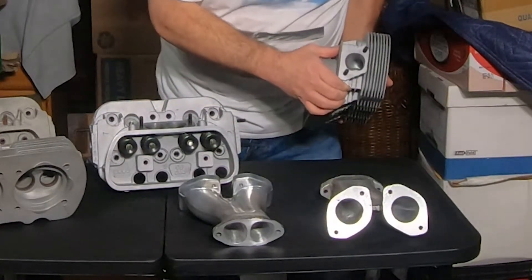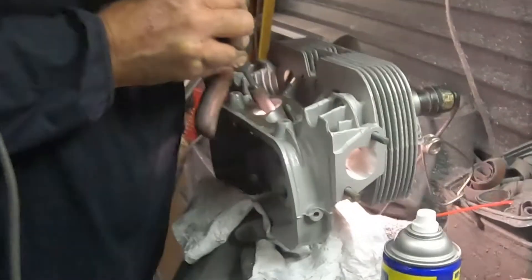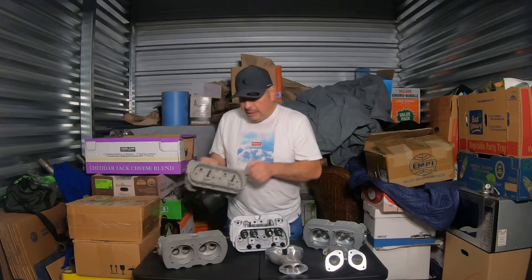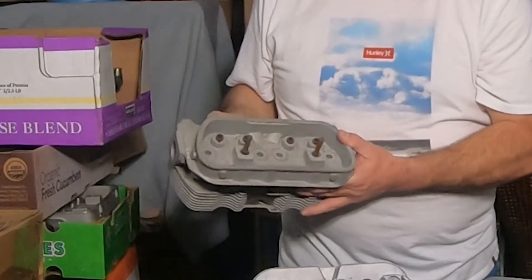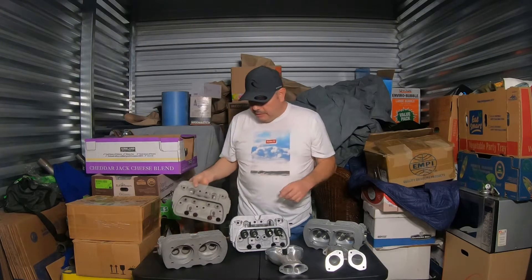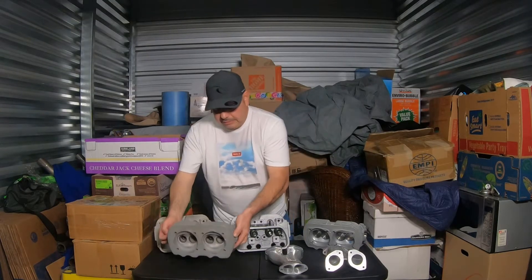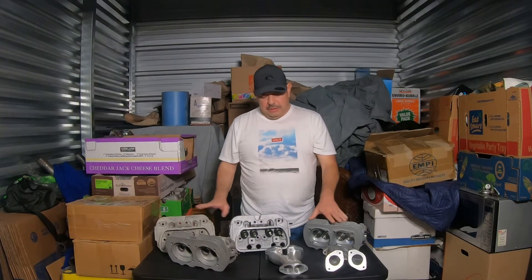The exhaust has been opened up to handle better flow. In today's video, I have a clip of some welding on modified heads that are getting port work done. It went through on the intake side on the bottom to where it poked through on the valve spring seat. You're going to see the welding that has to be done to repair the intakes and the seat, and then they're going to modify the chambers for a hemi cut. Those are not my heads — I can't show you the finished product, but I can show you the clips of the procedure for welding and installing a hemi cut on the intake port.